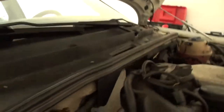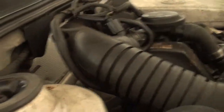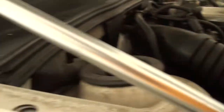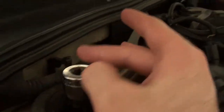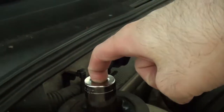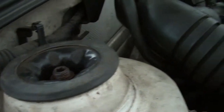So we just went and took a trip to Harbor Freight to get an impact and impact sockets, because these just spin of course, because of the strut and we don't have the specialty tool to take them off. You gotta put the Allen key in there and turn this. My dad had a setup where he trimmed this into a square where you could put an adjustable on it and then put the Allen through it, but we don't have either of that. So, impact.